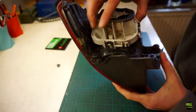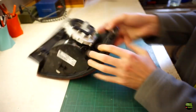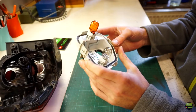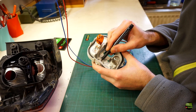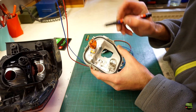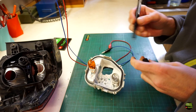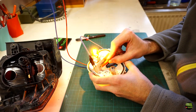Now we need to unhook the 4 hooks — actually I got only 3, because I looked at the wrong kind and one broke. The bulb base looks like new compared to a Fiat one I fixed a few years ago. This light has only 3 power lines for the 3 functions. The center one is negative or ground, one pin is positive for the blinker, and the third pin is positive for the position bulb — but that bulb has 2 functions: position light and stop light. The bulb is 21W. When the position light needs to glow, a lower voltage comes, so the bulb doesn't glow at full power. When we push the brake, the power to the third pin increases to full power and the bulb glows brighter as a brake light.